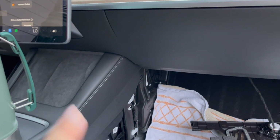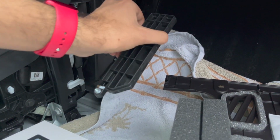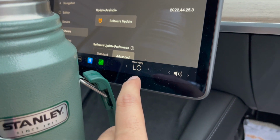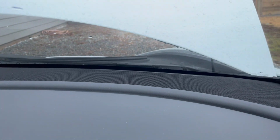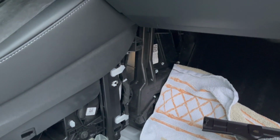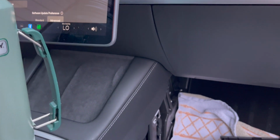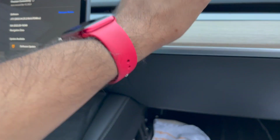So after you get the foam all up in there, let it sit for at least 5-10 minutes. I still have the cover off, and I turned the air on max cooling. I'm just gonna let it run for a minute. As soon as I turned it on, the foam that was in the little front inlet got sucked in, and this one should be making its way out as well. So I'm just gonna run the air on max for just a couple minutes, just so it dries everything out before I drop the filter in. But it already smells super nice in here.